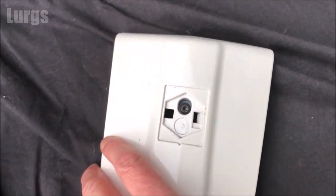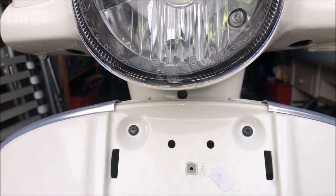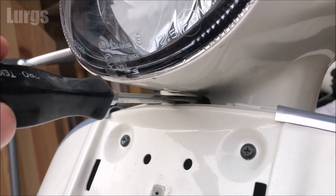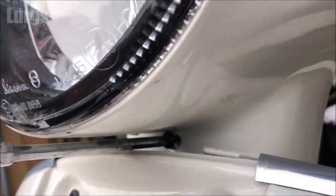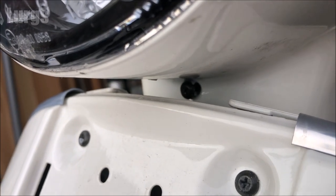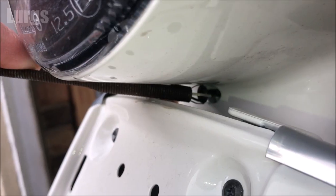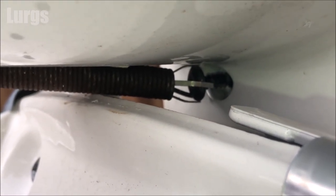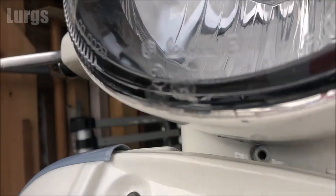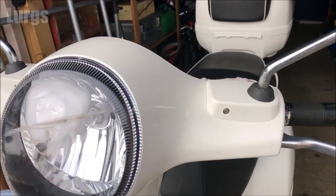This is one of the trickiest parts of the job: removing this Phillips screw just beneath the headlamp unit, only because below that is a big void and if you drop the screw it will just disappear and probably rattle around forever. If you've got a magnetic screwdriver use that because it is a magnetic screw. I'm just going to use this clasp — I've got it out as far as I can and then pull it out. This might be easier again if you turn the handlebars completely to one side. Luckily I did actually manage to remove this without dropping it — you do not want to drop it down that void.